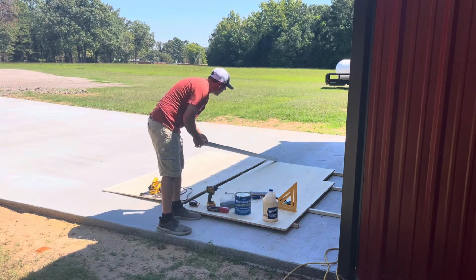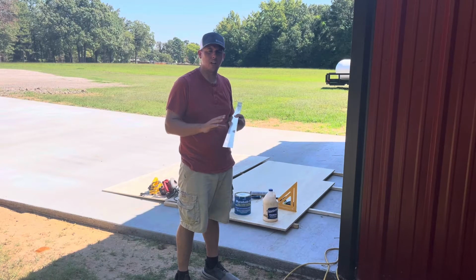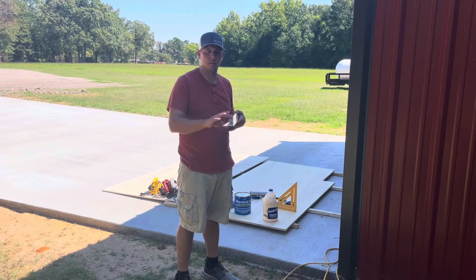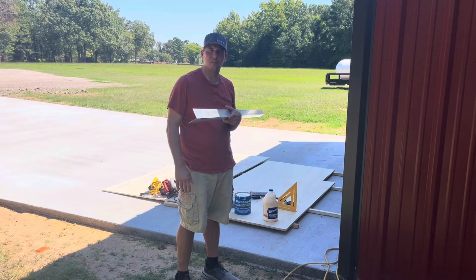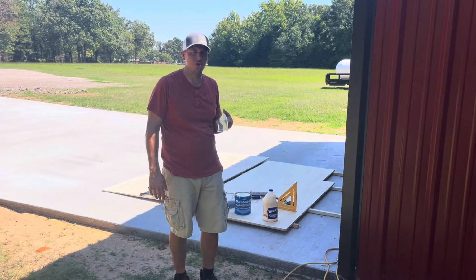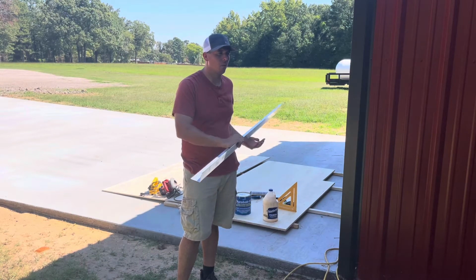Also, what I will do is I will change out the trim piece that's on the bottom of the slide, and I will remove the plastic slide skis because they're notorious for coming out on their own anyway. I will remove both of those items, and we're going to replace it with a piece of angle iron, aluminum angle, and it's going to now basically make the sidewall and the floor into one piece. It's going to be a transition piece, and there's no potential for water damage on the sides of the wood, and there's no potential for water intrusion. So this is one of the things that I will do when I replace a slide floor, and that's what we're going to do here.